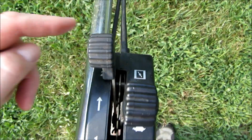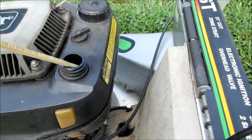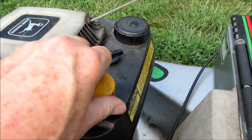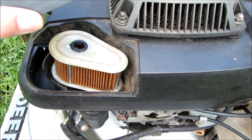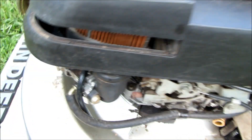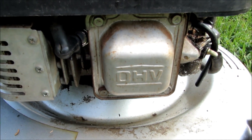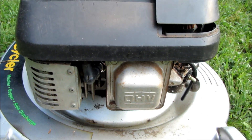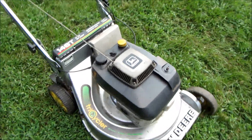It's got the 1 or 2-speed self-propelled and it has a choke. It doesn't have a lot of oil in it, but what's in there is clean — it's barely on the end of the dipstick. It's got a car-type air filter in it, looks fairly clean, I'll clean that out a little bit better. It's got an overhead valve engine and it doesn't look like those bolts have ever been taken off, so I'm not sure if the valves have ever been adjusted. He had taken this somewhere before years ago to get worked on and said it took forever to get it back. It's hard to find places to work on lawn mowers around here.